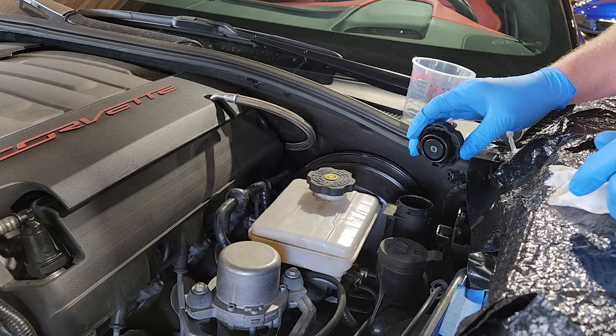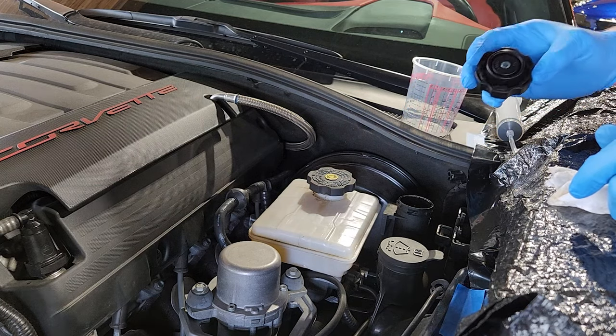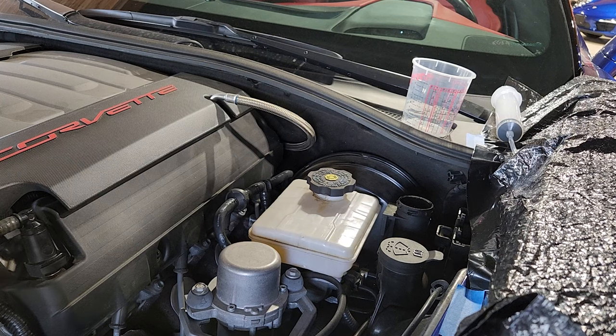When we're done cleaning this, push the plastic elements back in, get it taken back to the proper size, clean the cap out a little bit, and put it all back in. Once we put the new fluid back in, we're going to have to put the cap on before we pump the pedal — you do not want to have this fluid flying around with the cap off.